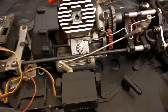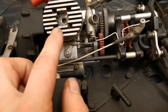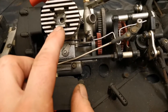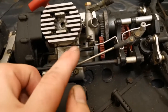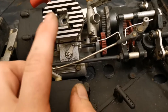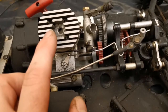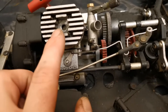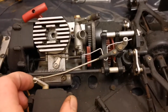It reminded me of a conversation I was having recently with a Facebook RC group member, talking about scavenging effects and whether you could successfully implement a supercharger on a nitro two-stroke engine. With a four-stroke, the exhaust ports and intake ports are open at separate times so you can build boost in the chamber. But with a two-stroke design, the exhaust port and intake port are open at the same time, so you can't build boost in the chamber easily. That's why you can make a blown two-stroke but it's difficult to implement properly. A lot of people go for something like a reed valve - snowmobiles can have a blown two-stroke, which is a supercharged, crank-fed two-stroke, with an exhaust restrictor reed valve system.